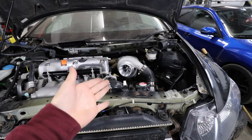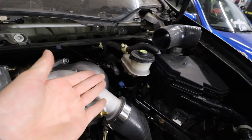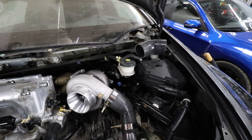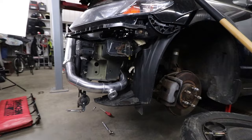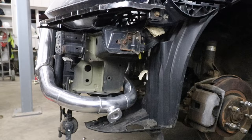At this point we've got the intercooler piping about 90% figured out and I'm really happy with how the kit is sitting - this looks freaking nuts. What I'm doing is getting absolutely everything installed and making sure it all fits, then it's all coming back out. Everything needs to get heat wrapped and heat taped - the wiring harness, all the exhaust components - because the master cylinder and brake lines run right next to the exhaust manifold. You do not want to boil your brake fluid. So let's cut this frame.